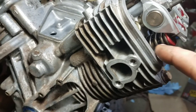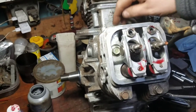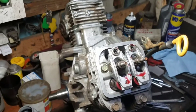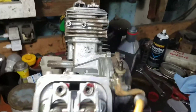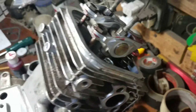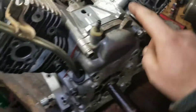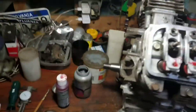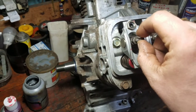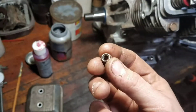I'm going to see if I can get some oil up in here. When I fill this up with oil, I'm just going to flip the engine right upside down with the vent capped off, and it'll soak the whole upper half of this engine. That will lube up the valves really good. Heads are all torqued down. The sump covers are torqued down. Gaskets are all in. When I go to put the valve covers on, I'm going to put a little bit of RTV on the threads so they don't leak — I don't really trust these fiber gaskets alone. These do have a plastic washer insert on them, but that's not going to be foolproof.